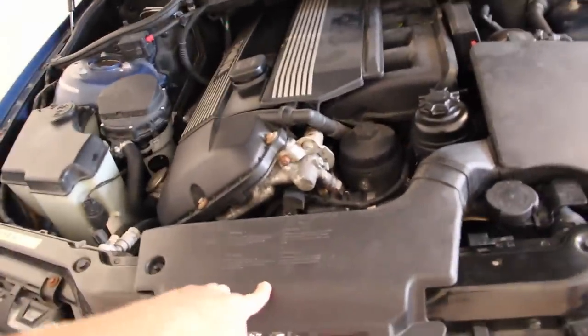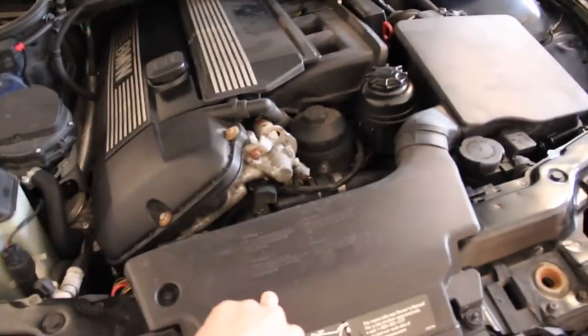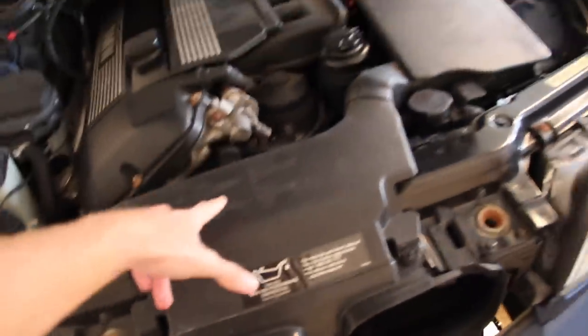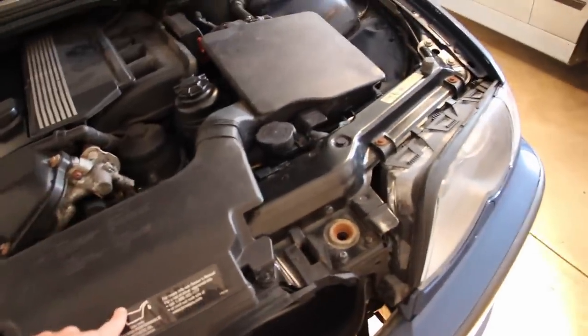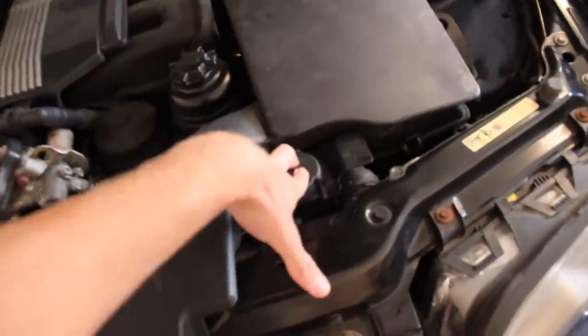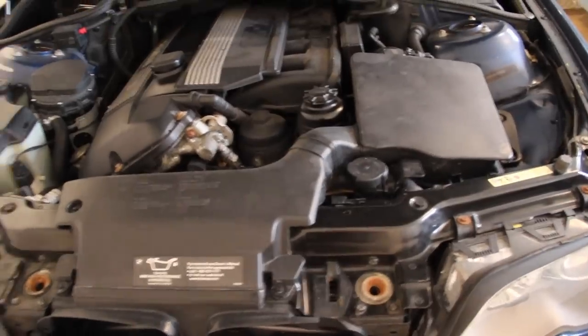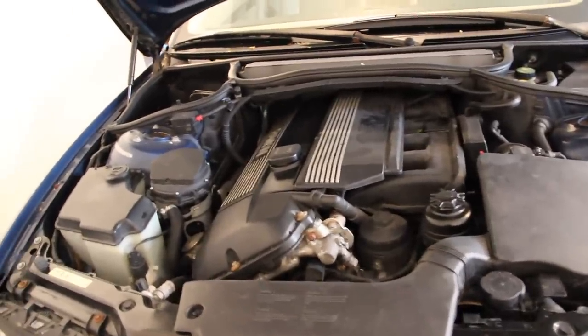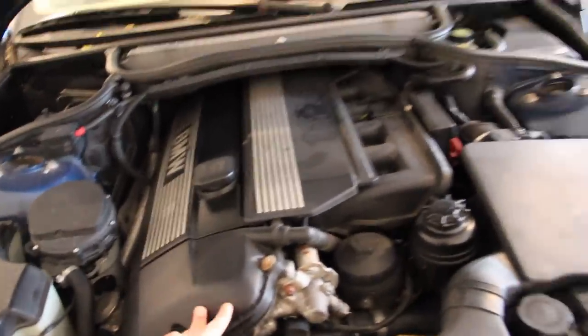The manual is a little different — some of the part numbers change. The manuals have electric fans instead of fan clutches, so we've got an electric fan in here. The radiator part number is different, the expansion tank might be, but pretty much the same. This is going to be very similar on your E39 with the inline 6 as well. This is the M54 B30, 3 liter inline 6.